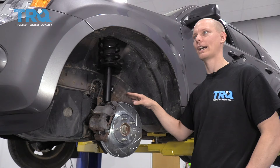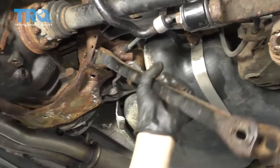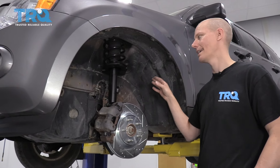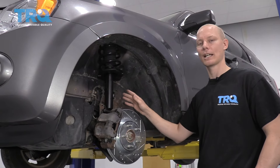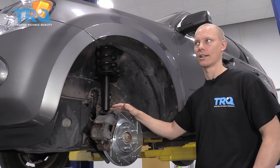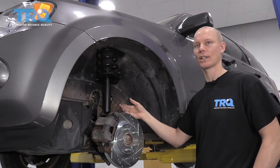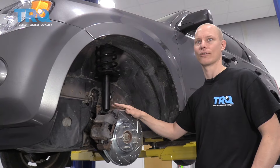On vehicles like BMWs you'll find multi-link suspensions, which have front upper control arms, rearward control arms, and rear lower control arms. There's basically a variety of arms in the front and rear suspension of these European cars, and the bushings end up going bad, which causes some misalignment issues, weird tire wear, and sometimes noises in the front end of the car. So replacing the whole control arm is usually the way to go rather than replacing just the bushing, because by the time you're spending the money and time on a bushing, you could have easily bought and replaced a whole control arm. It's definitely the more efficient way of going about it.